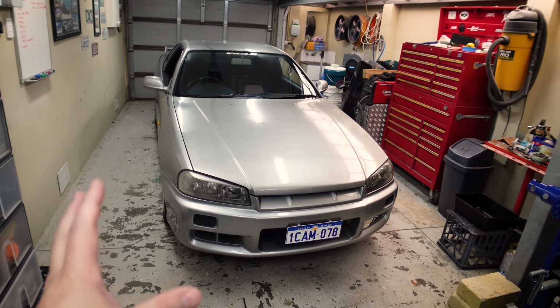So yeah, pretty easy swap. I mean, it wasn't cheap in terms of fluid. That fluid is about $100 Australian a bottle, and I went through 3. So 12 litres of fluid through this thing overall. And the filter and gasket kit from Kudos, that was about $100 Australian as well, if I recall correctly. So about 400 bucks to do a fluid service on the trans.